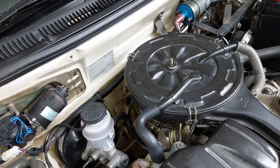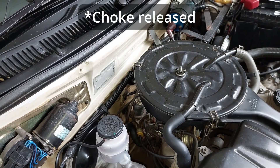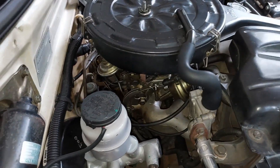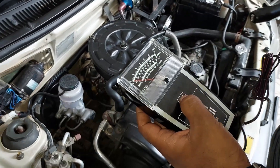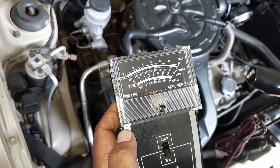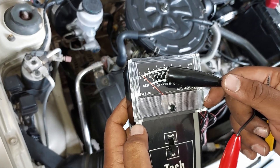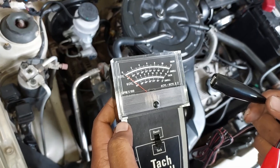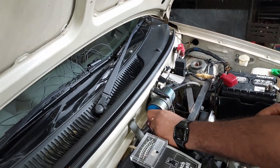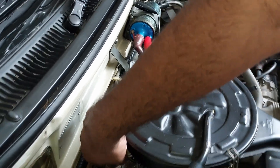Pull the choke completely. We may have to adjust the RPM. To adjust the RPM, we need a tachometer as the car doesn't have one. This is a tachometer suitable for 4-cylinder, 6-cylinder, and 8-cylinder engines - it's a dual tachometer. Readings for 4-cylinder should be read in the 8-cylinder scale: the RPM shown for 8-cylinder multiplied by 100, then multiplied by 2, gives the RPM for 4-cylinder engines. The black terminal goes to the negative of the ignition coil and the red terminal goes to the positive. The RPM was a bit low, so let's increase it by adjusting the idle speed adjusting screw.